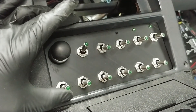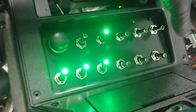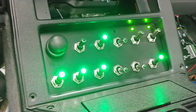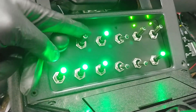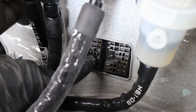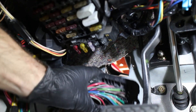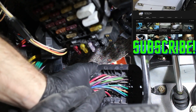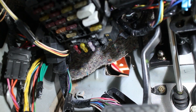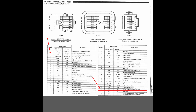This video will cover some of the LS wiring that I did to my car. To start out, I need to send power to this C100 plug. These two red wires need 12V power since the original harness is gone. On my 92 RS Camaro, I need to power the A4 and G5 wires.